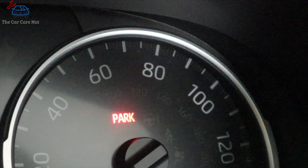Let me walk through the procedure in writing. Step one: get in the driver's seat, open the door and leave it open. Disengage your parking brake — turn the key on, foot on the brake, push the button down until you hear it disengage. Turn off the key, then turn the key on again. Press one, two, three quick up, then one, two, three down quick, then push it down and hold it. Continue to hold it until you hear the motor whine for a long time. That's the motor coming back out until it stops, and then the light on the dash starts flashing — not rapid flashing, but a steady on-off as you see in this video. That's when you know it's in service mode.